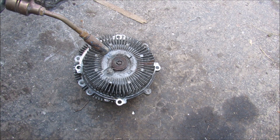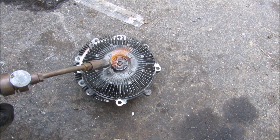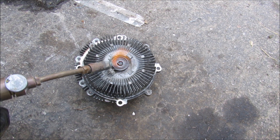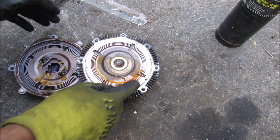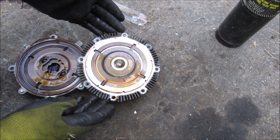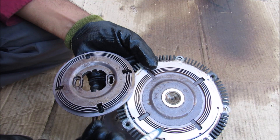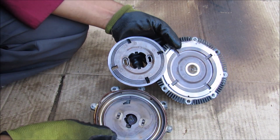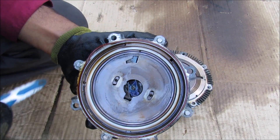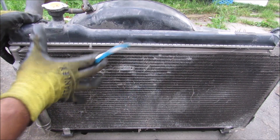Applying a little bit of heat, you can see that the spiral is starting to slowly expand on the outside. The spring is not getting hot enough from this propane torch, but you can see how the liquid has kind of melted and made its way around the outside — it's actually a little bit less viscous when warm. When the temperature cools down, the fluid is going to make its way back out of these channels into the radial channels and back down into the center chamber, where this valve is going to close and keep the fluid contained.